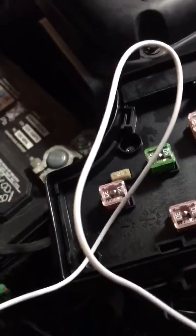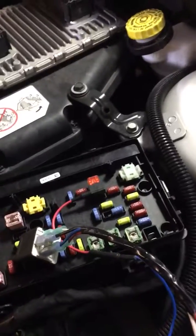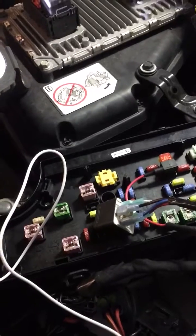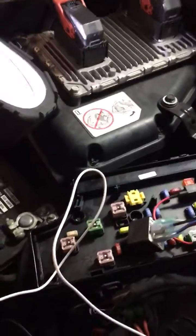connections right here. So what I'm gonna do is show you that the relay won't actuate until I turn the car on. That way, your lights are only working when you have the vehicle running. So it's gonna be running parallel to the regular PWM pulsations that the car has. That way, for whatever reason the computer doesn't like it, it always defaults back to the regular light. If you have any questions about that explanation, please fire me an email by all means.